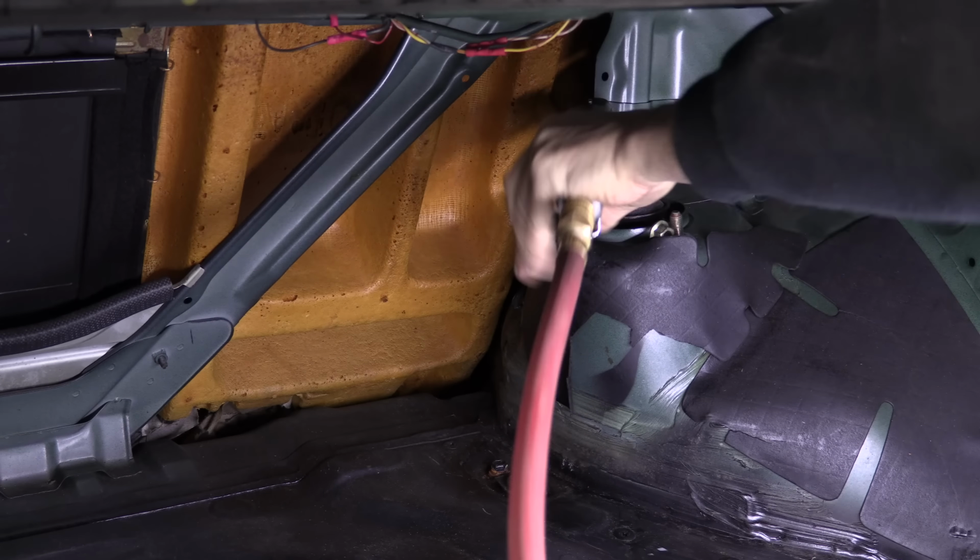When you separate the ball joints using a joint separator, you are preloading a massive amount of torque onto the stud. When the tapered stud lets go of its hole while you're beating on it, all of that force is applied instantaneously. If the other end of the arm isn't bolted down, you've created primitive artillery. It can happen. This is the reason why the service manual has warnings in it.